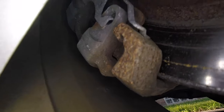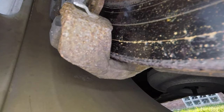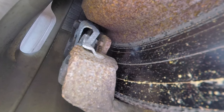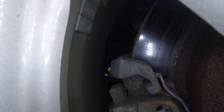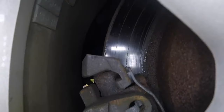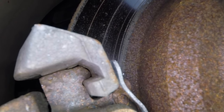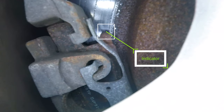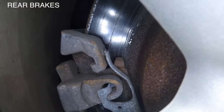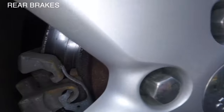There we see the brake caliper. We are looking on both sides. Somewhere on the brake caliper you will find an indicator — a wear indicator. On this car at least. On the right side we can see it, though it is difficult with the camera depending on how big the hole is in your rim. The indicator will touch the brake rotor, and once it touches it, it will make a noise — it will squeal and squeak.